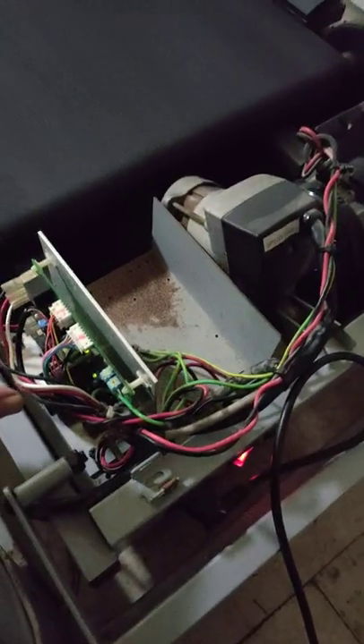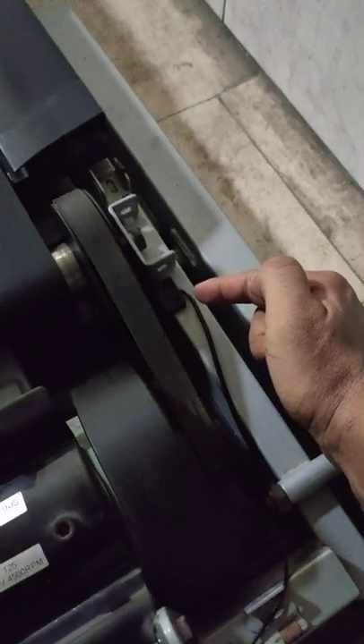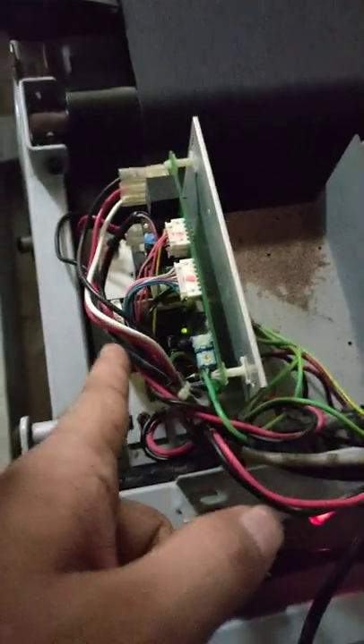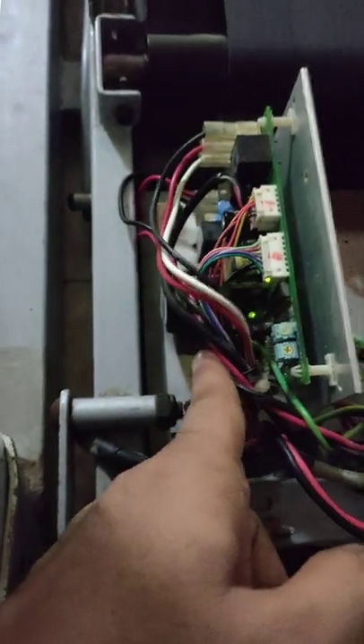See, it's running properly now. If E7 error is coming and the belt moves for only five or six seconds before showing the error, you should check the speed sensor — keep it level. If the problem persists, change the speed sensor. If the motor and belt run for five, six, or seven minutes before the error, the fault will be in the bridge rectifier, MOSFET, or IC on the board. If the motor is not moving at all, that also shows E7 error — it indicates a faulty motor.